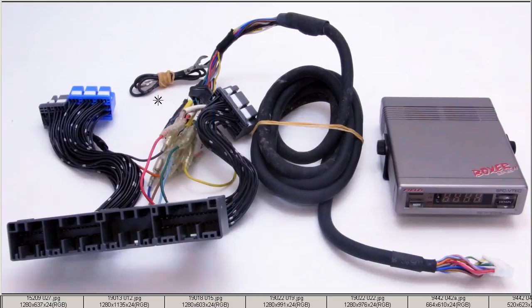This also includes the vehicle-specific harness, which makes it a lot easier to install for the Honda H4 type vehicles. This harness is called a VTH4, for the H4 type ECU configuration. And as you can see there, it makes for a very easy install. Just simply plug it in, plug this in, and the regular ECU harness then plugs into this block here.